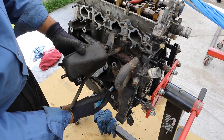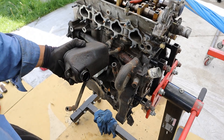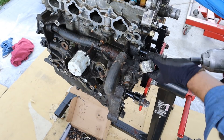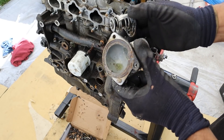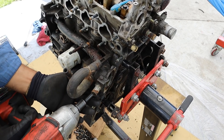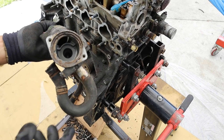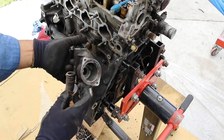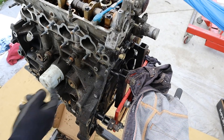What the oil separator does is it ventilates vapors from inside the crankcase and sends it back up into the intake system to get recirculated — it's just some giant baffles inside of there. I'm going to zip off these thermostat bolts, and there we have the thermostat and the thermostat housing. Next I'm going to remove the bolts that hold this to the block so I can remove the entire bypass hose assembly and thermostat housing. The coolant temperature sensor sits right here into the head.